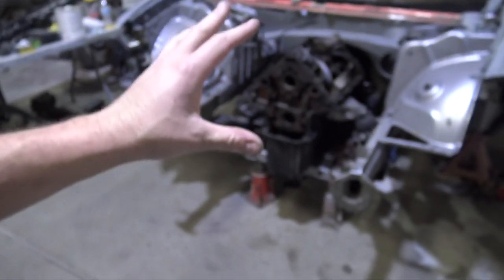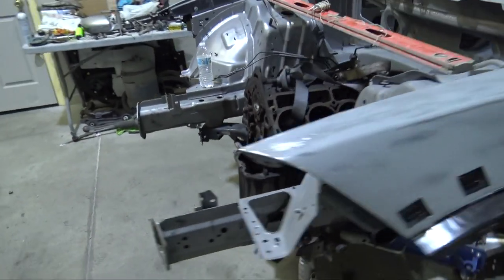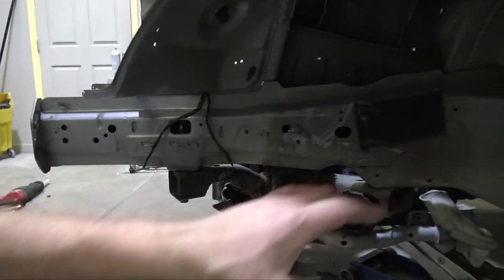It's been a pretty slow process, cutting, test fitting over and over again, but I have this pretty close to where it needs to be. So the diff is as high as it can go with the factory oil pan. Like I said before, I'm probably gonna end up running a dry sump on this engine, or the built engine, but I wanna make these subframes so people don't have to buy a dry sump if this becomes a very, very common swap,